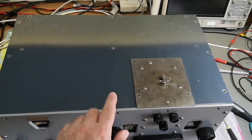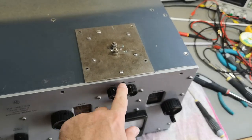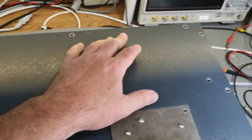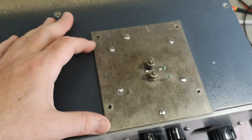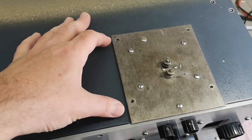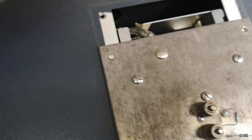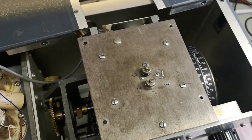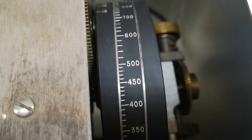Now we're ready to take off the lid. We need to take out the three screws here, and all the other top screws. On some models you only need to loosen four screws because there's a bottom bracket fitted to the top lid, but on this model there's a thread in the top plate so you need to take out the entire screw.